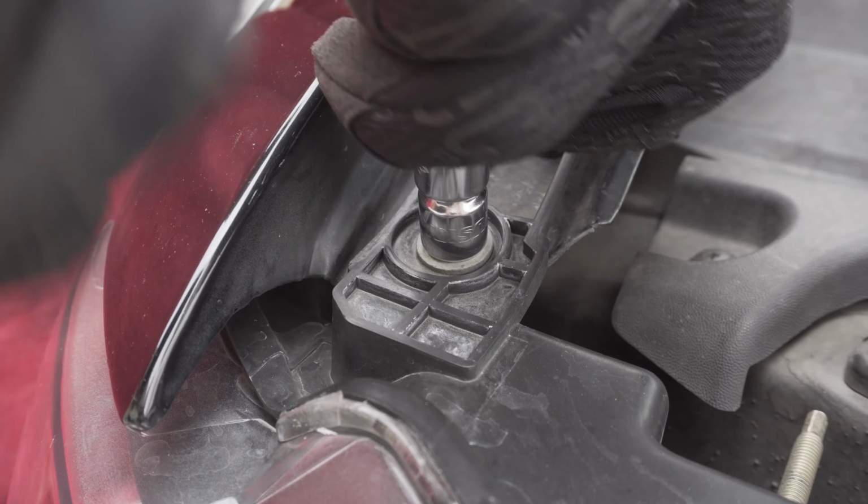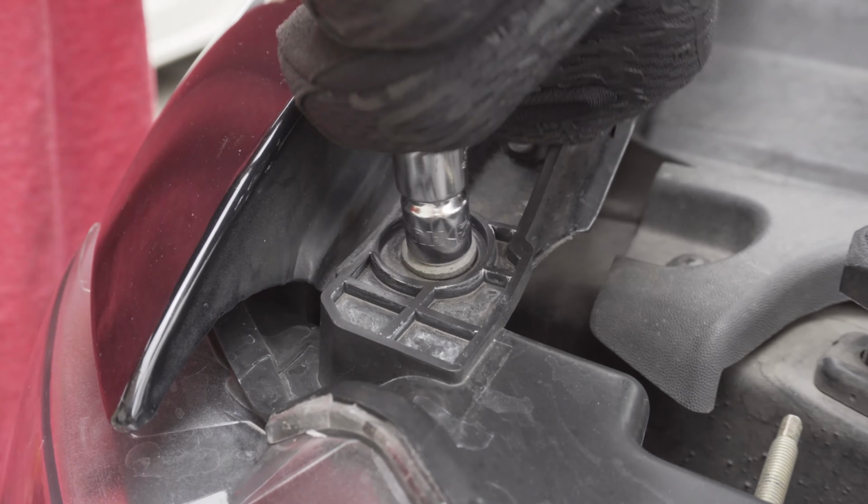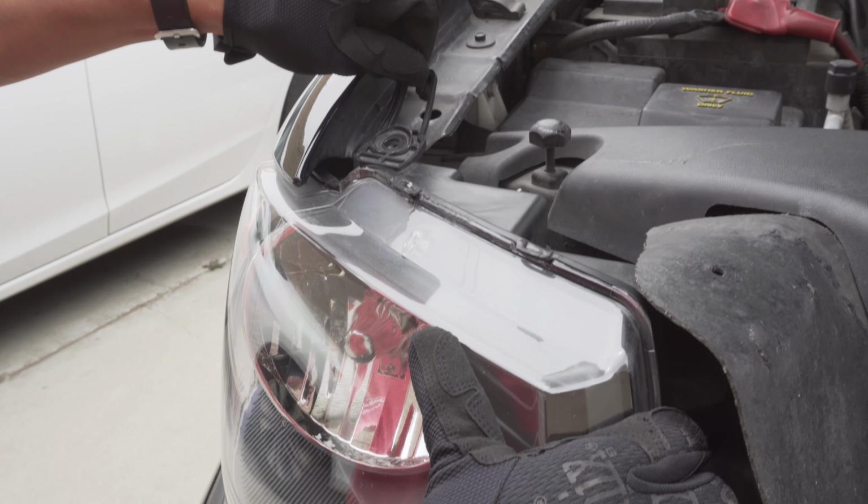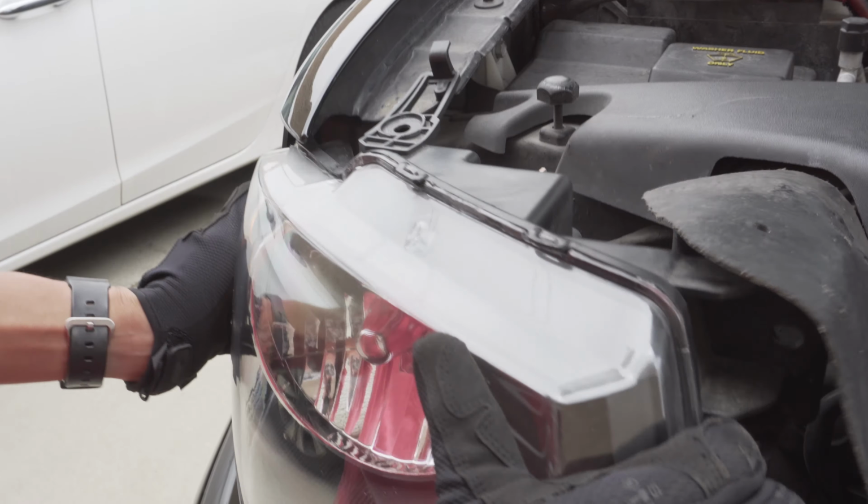First, you'll want to start by removing the two bolts located on the front of the headlight housing. Next, you'll want to remove the bolt located on the top of the headlight housing. You should now be able to pull the headlight housing out, which will allow you to access the running light